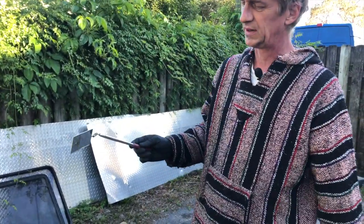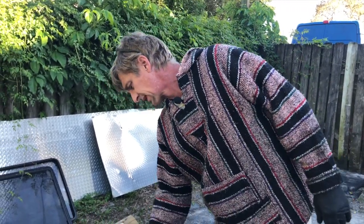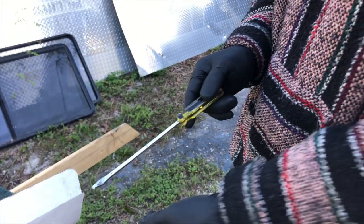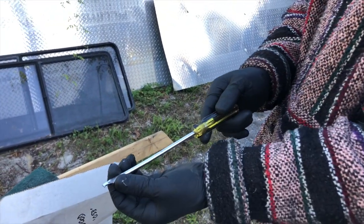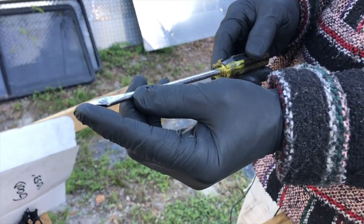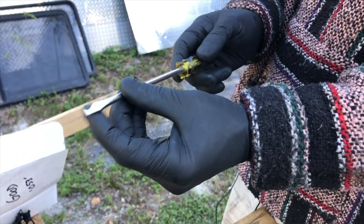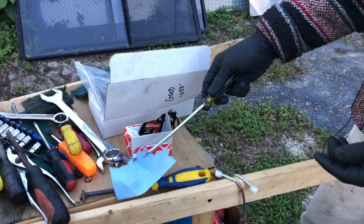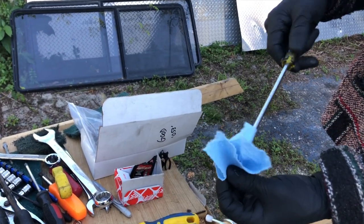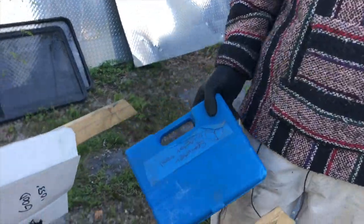Inspection mirror for looking down in the holes — got to have it. We use our phones, works pretty good. The right size flat screwdriver that will slip into the injector seal and catch it, and also some kind of hook tool to pull them out if you need to. We've modified this one to make it both — also works pretty good for getting in there and pulling out little bits of towel. Paper towel down in the hole — once you turn it a couple times that barb really gets stuck in there. Injector puller tool — we'll have a link for that down in the description.